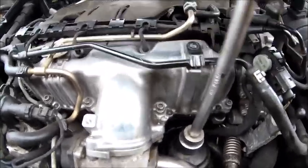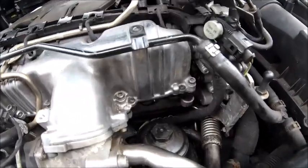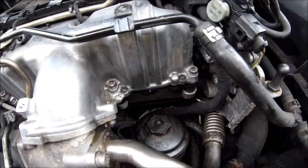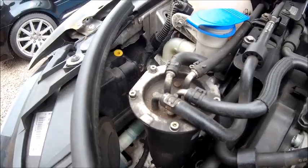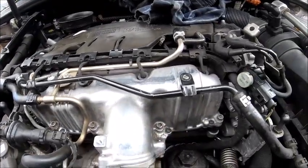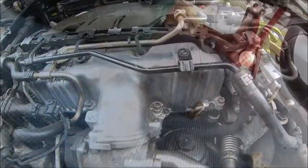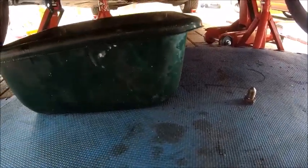It seals with the o-ring — that's what the o-ring is for. Just make sure it's going on correctly, not cross-threading, and snug it up. Officially it's 25 Newton meters. I've worked for an engineering company for many years so I can pretty much get torques within a few Newton meters. Filter's in. All that remains is to get the sump plug back in, chuck some oil in, then do the fuel filter, and try and do the cabin filter — I think that's a bit of a pain on this one.